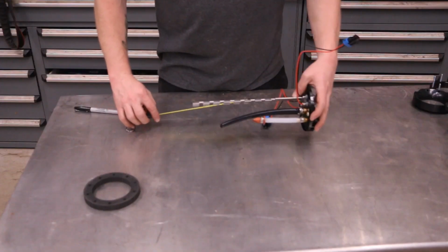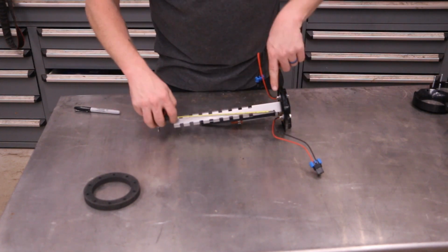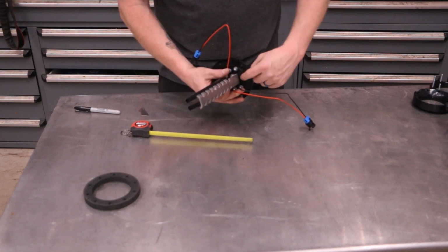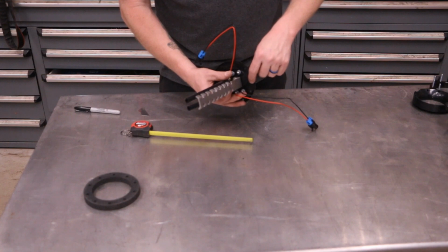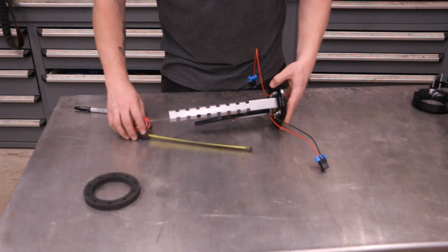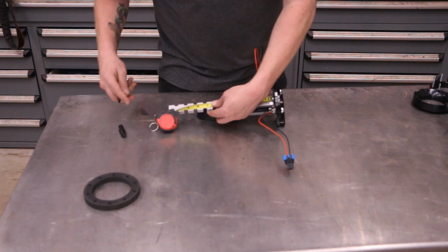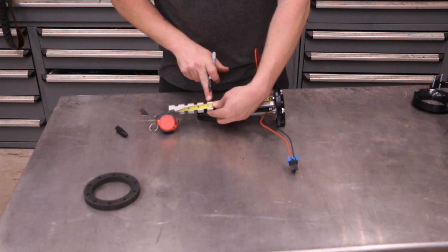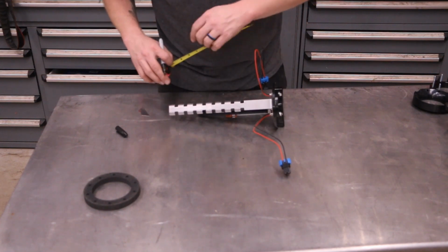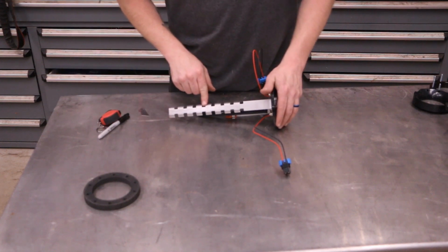That's the number. So we're going to take our pump top hat. This is the backbone, and we're going to go all the way to the bottom. There's a recess here. We're not using this. We're using this right here. So not the recess. We want to make sure we go off of the exact point where the backbone bolts. Put that up here. We're going to come down to exactly 7 inches, which is the bottom of this rib. In our particular case, that is 1, 2, 3, 4 ribs. Okay, and we're gonna take this over to our bandsaw and cut it.